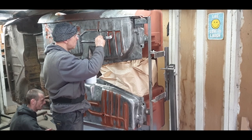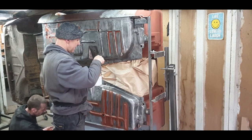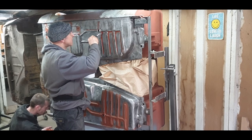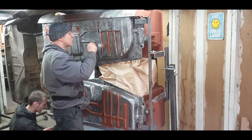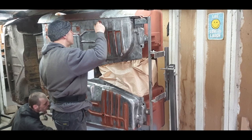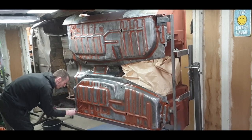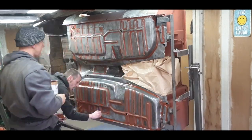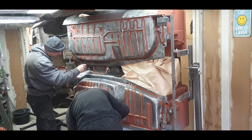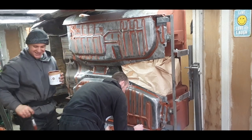This is so that when we're spraying in a groove, you get a little bit of bounce back, which stops the paint from going directly into the edges. So the stripe coat is put on first so that we've got good coverage. Looking good.